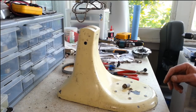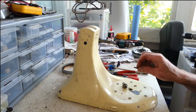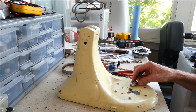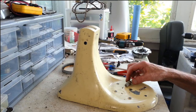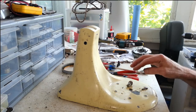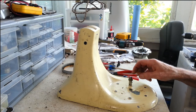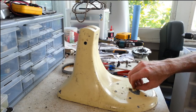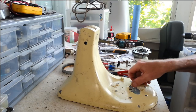All right. Well, more time has passed than you realize from watching here, but we did get this pin and this part out. This we can get cleaned up and polished up good. There was quite a bit of corrosion on there holding everything in. It'd be easier to tape this up and end up with some kind of edge on here, so it won't peel the tape off after powder coat. This did take a heat gun and quite a bit of work just to get this out of here, but it's out now. So persistence pays. You see this is still warm where I can get this paint that was chipping before. It's just peeling right off of here, and there's some of the original white paint.